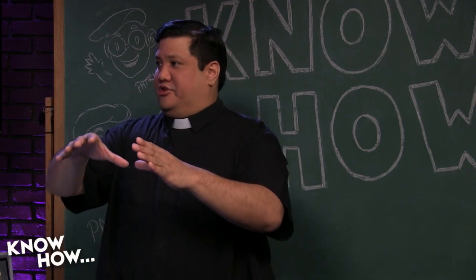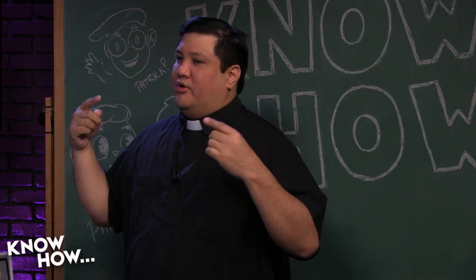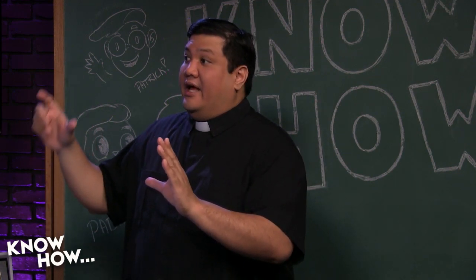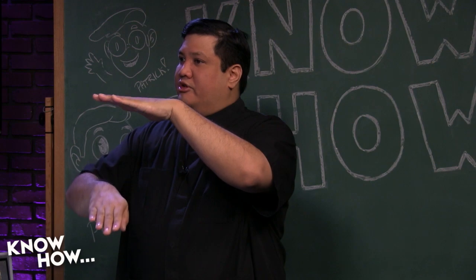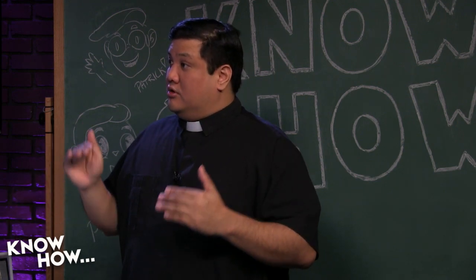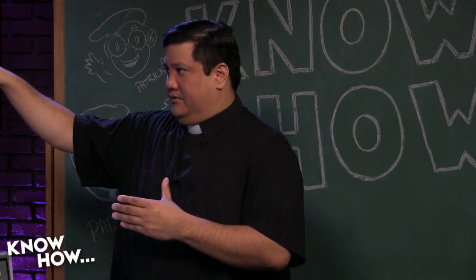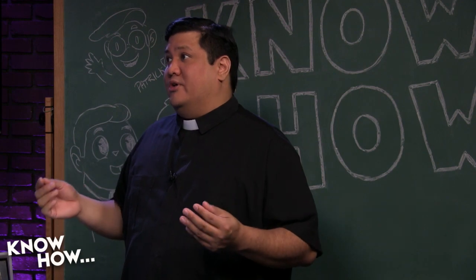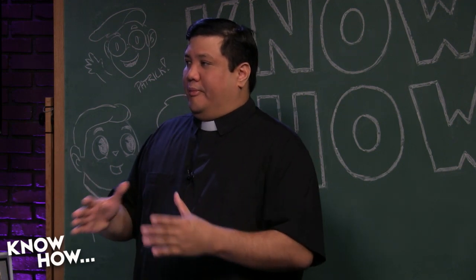Right. So I've got my processor. I've got my memory. The memory is sort of like the brain space of the processor. Anytime the processor is executing code, it's executing it inside the memory. The memory is fantastically fast. Then I go a system down, and connected through the PCI bus is the storage. The storage is typically an order of magnitude or more slower than memory because you're not executing things out of the storage. You're transporting things in and out of memory and then executing it in there. So it's good to have fast storage, but the storage does not need to be as fast as the system memory, because if the system memory is slow, it will bottleneck the processor.